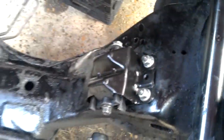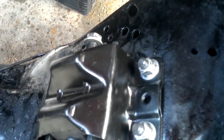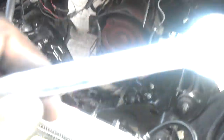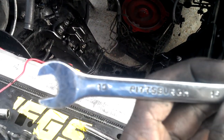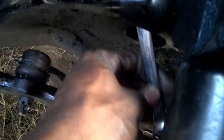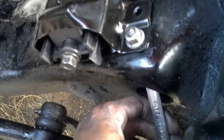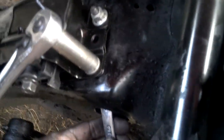All right, on here you got the two top screws — one and two. My cheap 15 millimeter wrench, that's all you need. A little short one, or a long one, whichever works best for you. Stick your 15 in there, it's going to be kind of at an angle but it'll grab that bolt up under there. Then get your ratchet — 15 up here too.